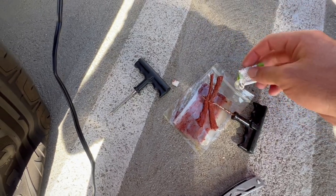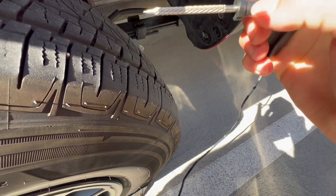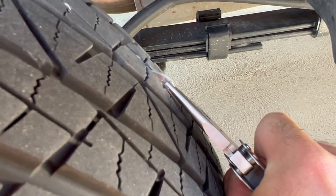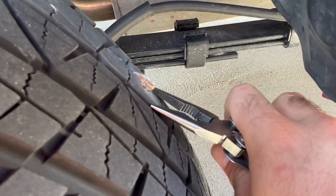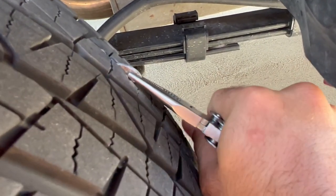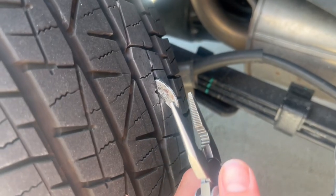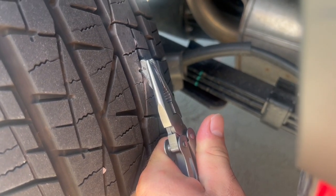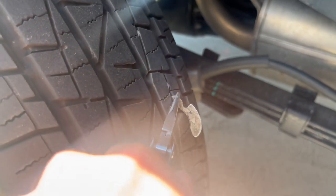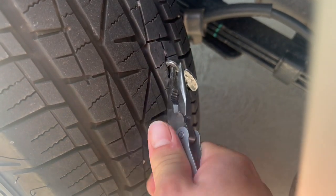After you apply the cement, you pull that out and want to put the reamer in there and kind of rub it around the hole just to get it prepped and ready for the patch to bond to it. It's pretty tight in there. I got most of it out and now I think it just needs a little more — let's see if I can pull this out.